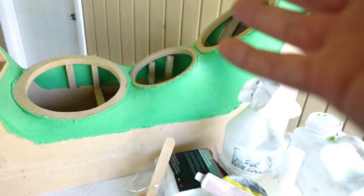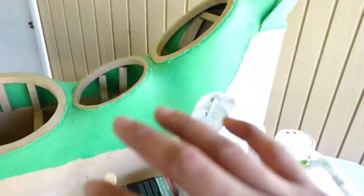If we were to go the extra mile and paint this console, it'll never crack. On my Trailblazer outside, guys, everything that's fiberglass painted is the same product that we use, and even to this day, I've yet to see that thing crack. I've seen other occasions where people build fiberglass panels, wall panels, door panels, and a month or two in this hot sun, especially in Florida, that thing is going to crack. It expands on the inside and creates a spider crack. And if your preparations of paint aren't right, that thing is going to crack. And it's bad news, because then it takes a lot more to repair it.